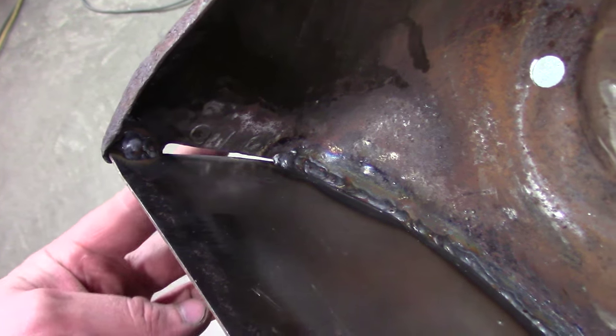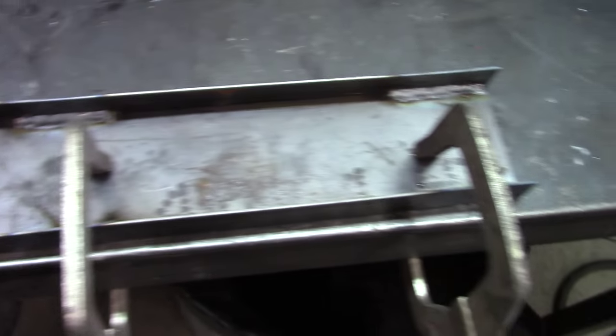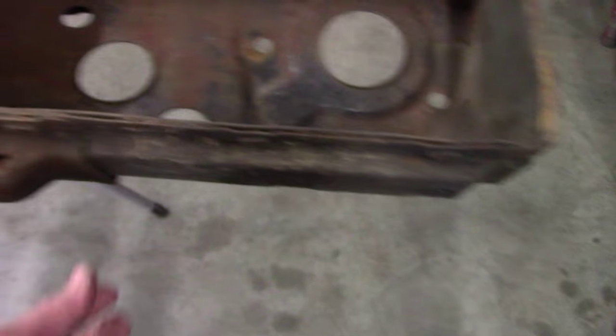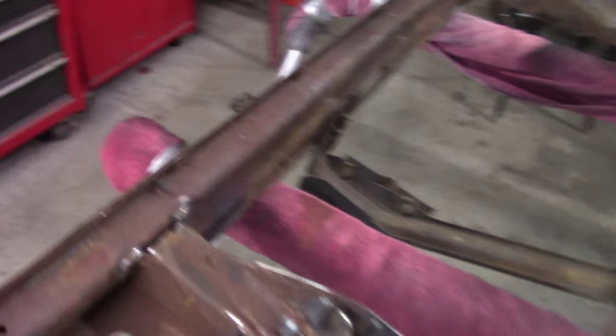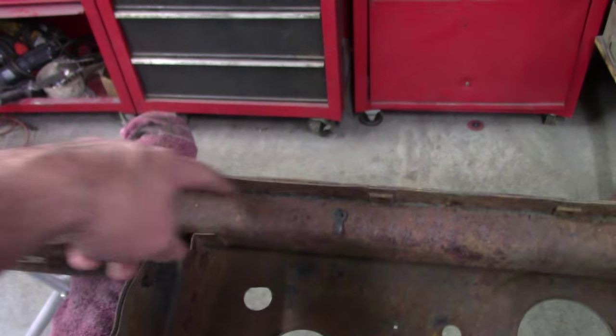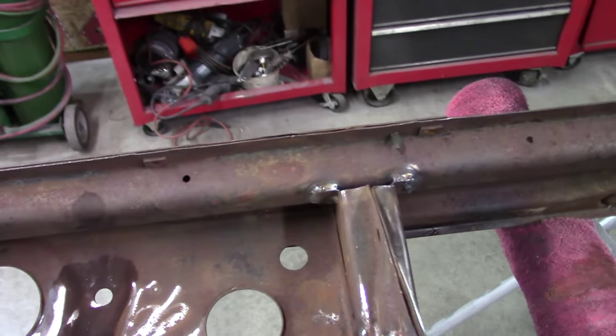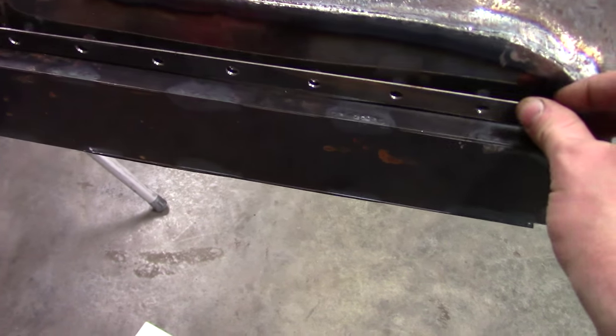Here it is hours later, and this is what I came up with. I left this space open because I originally had a tab on the next piece that folded up in there — I'm considering recreating that. But if you look down it, I got the angle pretty close. Here I'm MIG welding up a channel to kind of emulate this channel here, and then I'll make another piece to go on top of that. It's a tricky thing to put together because a lot of these planes aren't parallel. I want to double wall it so I can attach the wheel wall. I drilled a bunch of holes in it for some rosette welds, and I'm going to repeat the process for the other side of the C channel.